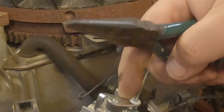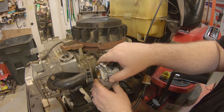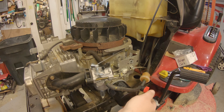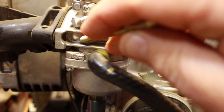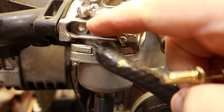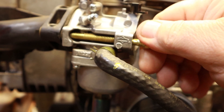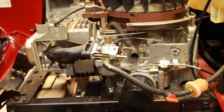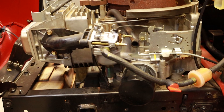Put your throttle linkage in first, making sure it's hooked down in there and in the correct hole. Once all the linkage is hooked up, put the carburetor back up, install the gasket, hook the wire back on the bottom, and hook the fuel line back up. I also want to pull this front stud out — something I should have mentioned earlier when showing the parts kit. The welch plug underneath here: if you have a surging issue, check this welch plug. Just make sure it doesn't have a hole in it or hasn't vibrated out — that will definitely cause surging.